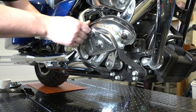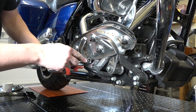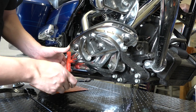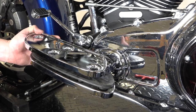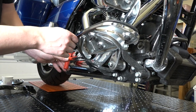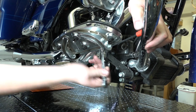We've got to get the floorboard off first — we just don't want it in our way, it'll make the whole project easier to install this extended brake lever. We've got a tall rider we're doing this for, Lurchy, 6'3". Don't forget to check out our other video where we show you how to install HD brand extended floorboards for tall riders. It's a 3/16-inch Allen and a 7/16-inch wrench he's using.